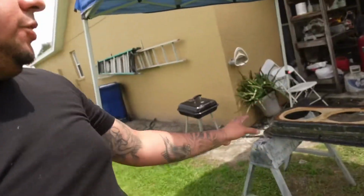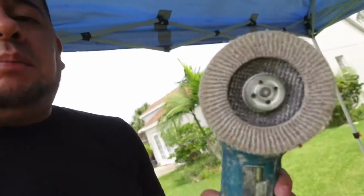Look, man, we're just gonna jump right in here and start sanding these door panels because we need to get them done, more hardened than what they were earlier. So I'm just gonna use the grinding pad that's on right now on the Makita grinder. Once we get to a certain level down after grinding the top layer of the resin off, we're gonna switch it over and put a new 80 grit on it, so it'll get a fresh new scuff.